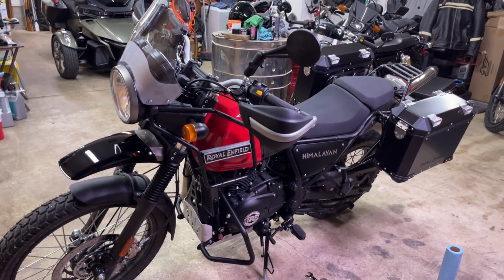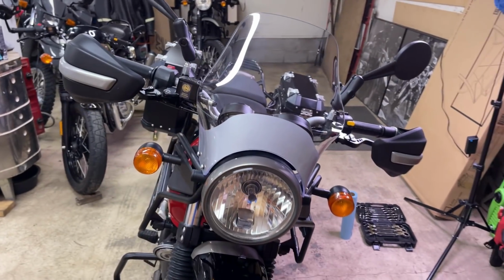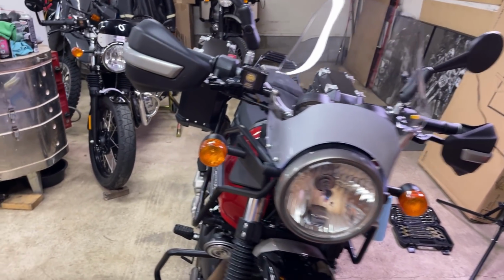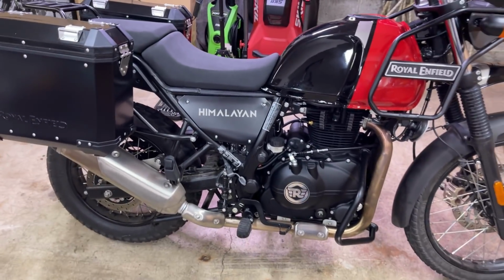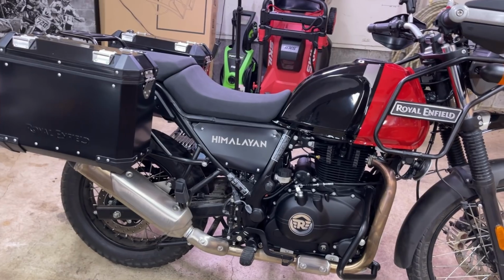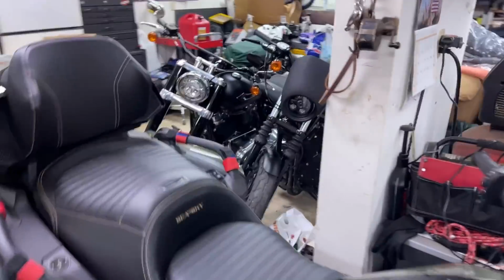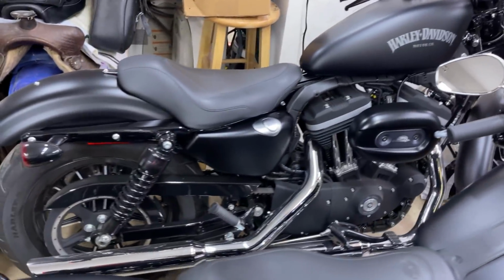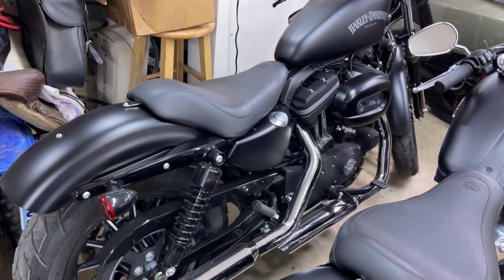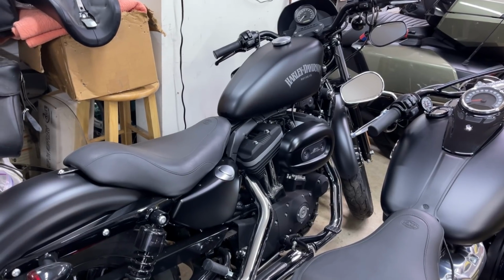It all worked out. I bet you she just about can't pick that thing up off that side stand. So that may just work out fine with the lowering link. It's deceiving how small of a difference a change in the side stand can make. Because I remember I went, was it 2 inches? I went 2 inches up on my iron on the shocks. Was it 11? Yeah, I went from 11 to 13s. And that thing almost tipped over on itself. It was leaned over so far. So I did some checking and they say go 1 inch shorter. So adding 2 inches to the shock took a 1 inch shorter side stand to make it fit.